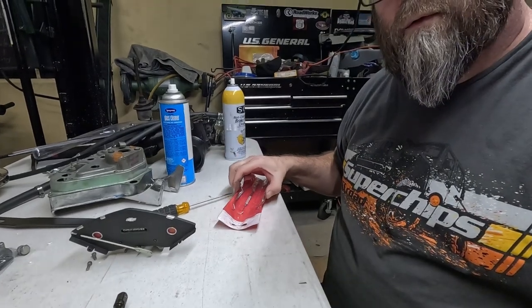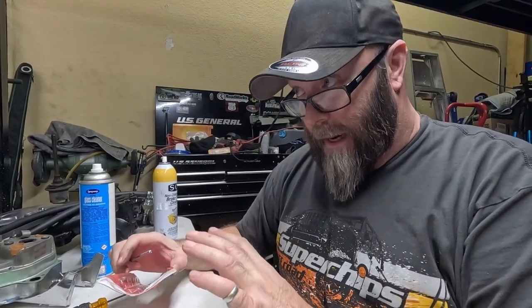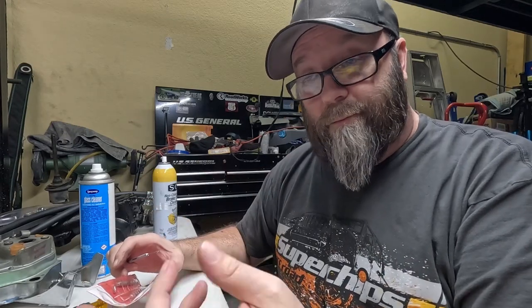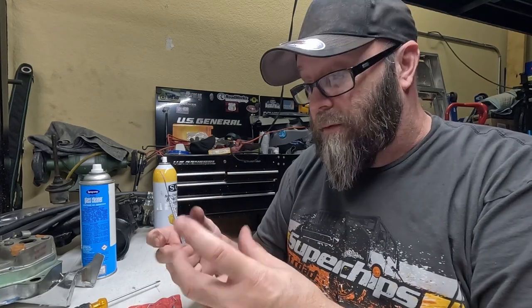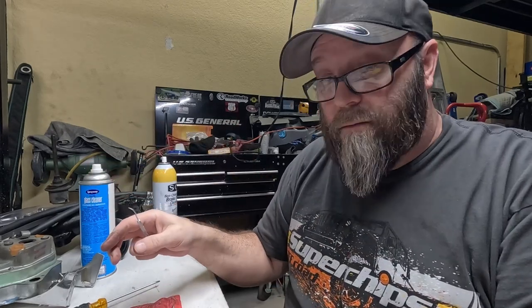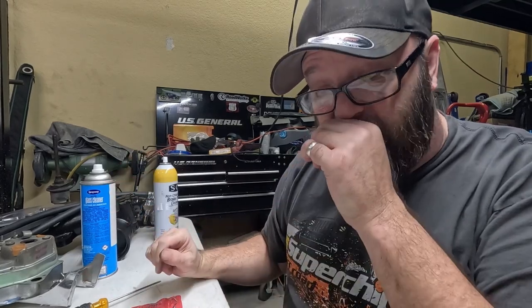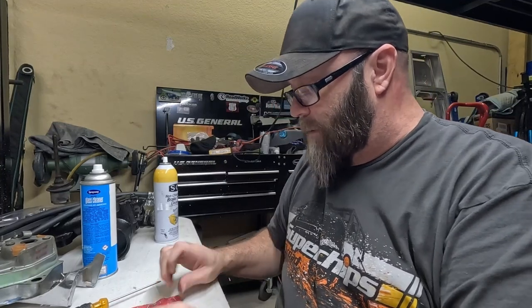We had the steering column already down. You want to do that. If you're not taking the steering column out, you definitely want to lower it about those two nuts we took out earlier that allow the steering column to drop out. You want to take those two nuts down to maybe one or two threads worth of turn, so that's as far down, and that way you have less of a chance of the bottom of this scratching your steering column and all that when you're wiggling it out. But we already had ours dropped, so that was part of it.